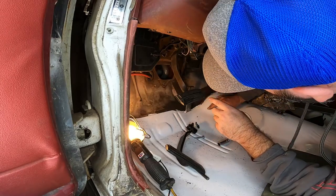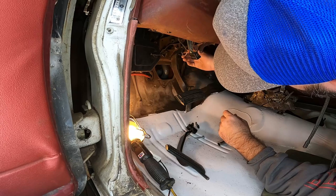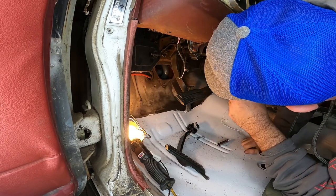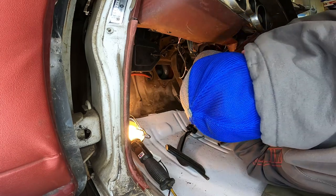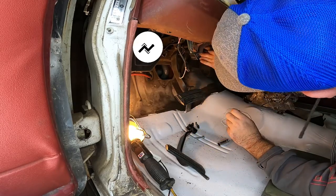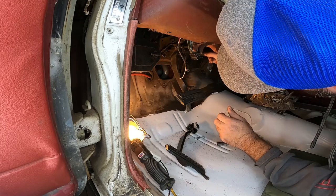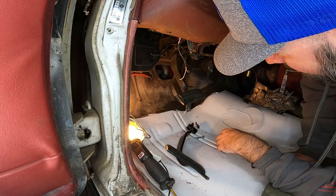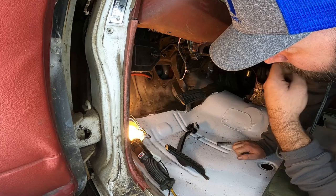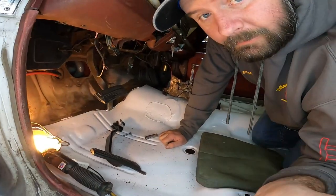So what I gotta do is take the master cylinder back off, and I gotta undo the brake light indicator here. That's easy enough. But there's 4 bolts that go into the master cylinder on the firewall. Those gotta be taken off, and then I got just 2 half inch bolts in here, and then this can come down and pull out, and then I can take this to the bench and swap pedals on it. That's just way too damn high. It'll be super annoying. The interior's out of the car, might as well do it now. And once I get that pedal out of the way and work on it on the bench, I can get a better look at some wiring down here.